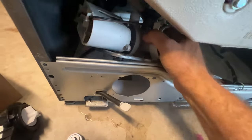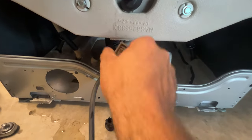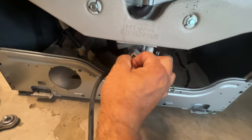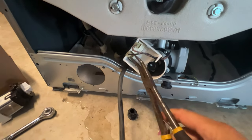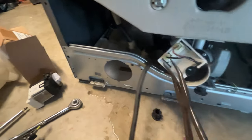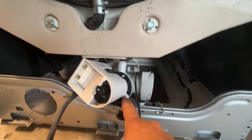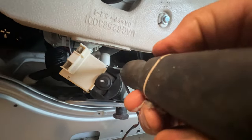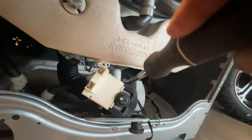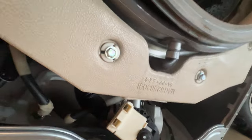What we need to do is get to this side. If I disconnect a couple more of these hoses it should come out better. So I just pulled it out to the side — we've got two wires on it, a brown on top and a black on the bottom. They should just pull right out. I got a little case around it, looks like it's held on by just this one Phillips head. Cover pulled right off. There's two more screws that should take this water pump out, and we're going to hope that this is the problem because it was not pumping water.